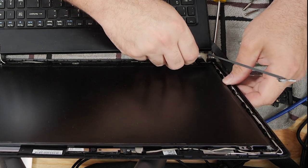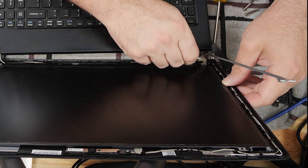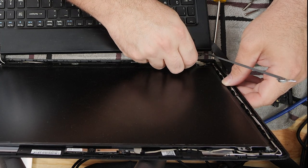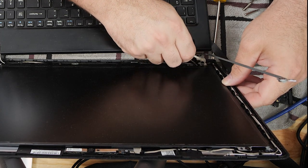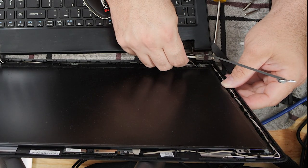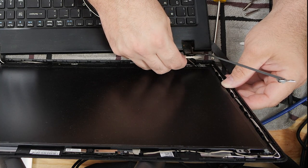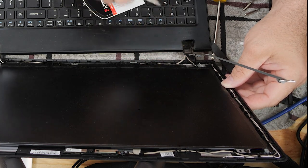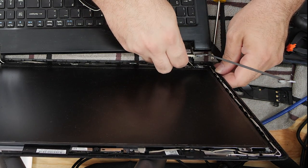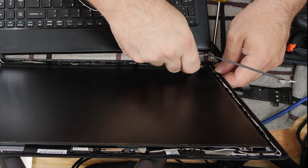If you can get new plastics and fresh hinges, that's cool. One of the problems is if the model breaks like this and it wasn't dropped — if it's actually a problem with the way the hinges are designed on a particular laptop model — it's not going to matter what you do, because the hinges tighten up over time and you've got to toughen up the base to compensate.